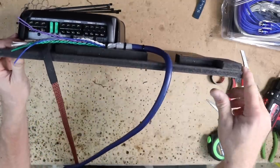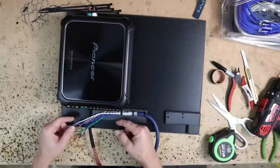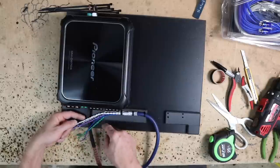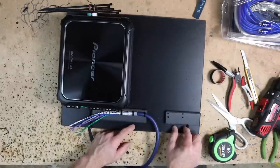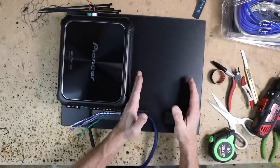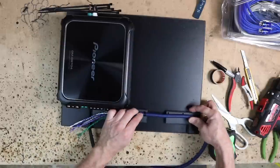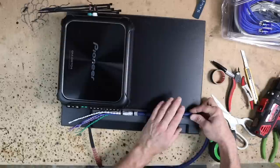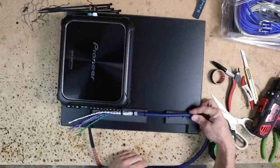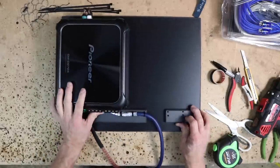added more half inch here, this groundwork. And really the problem in that bend is here on the power side. So I wanted to make sure we could go the full length down to this to bend that power wire. It's gonna go into this channel right here and come out. And then there's this area right here. So if we were to take this amp and move it here as a mono block, this is where the power wire would be going into that next one. So this is going to zip tie across like this along with the RCAs. And this area here would be where the mono block is gonna go and the stuff won't get in the way. And then our RCA is gonna run up here next to it and go like this. So that's what we're doing right now.